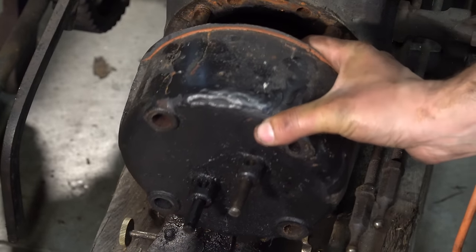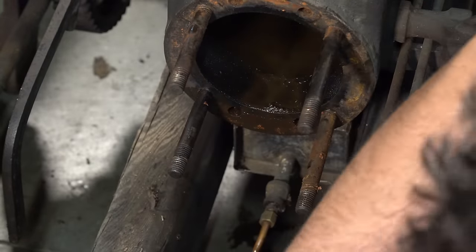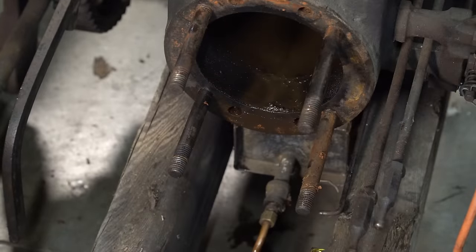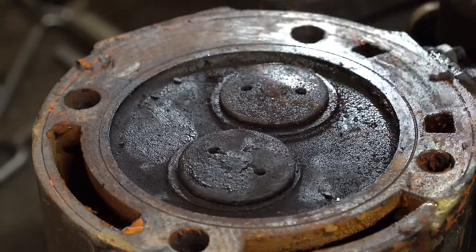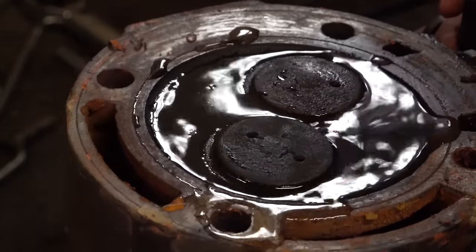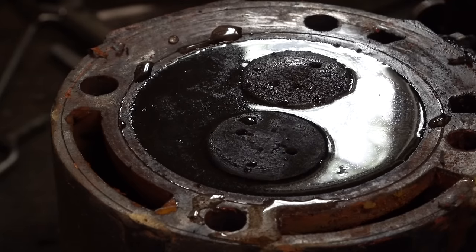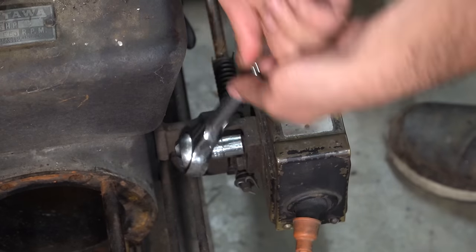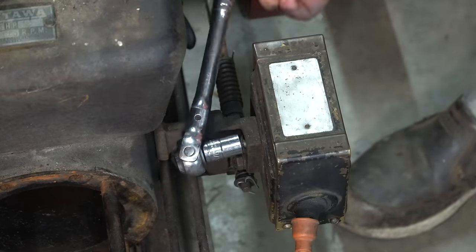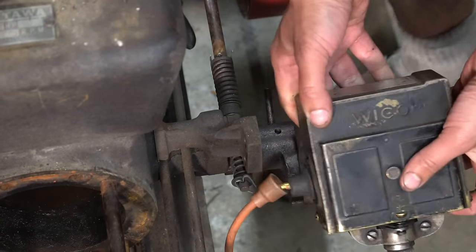The repairs look like they're due to frost damage. This is where water flows to keep the engine cool, and if you didn't drain it in winter, the cast iron can't expand and you get cracking. With the valves off, I can test whether they actually seal, which is critically important for this four-stroke engine. It seems like they do — after leaving gasoline there for a while, the level didn't lower at all, so I'm confident and very happy I don't need to lap them, though maybe I'll give them a light grind anyway.